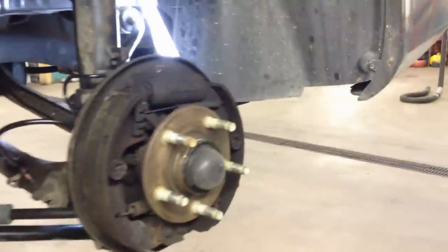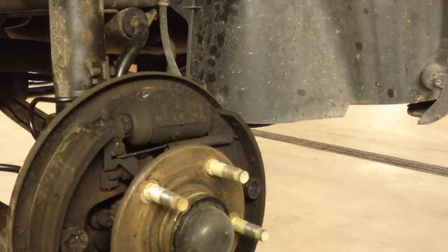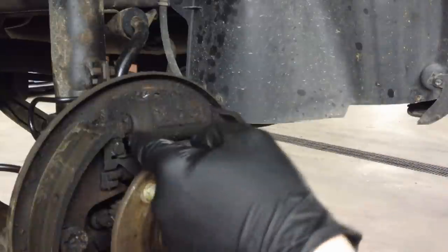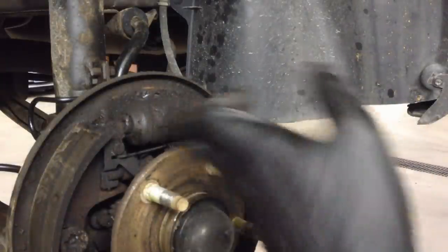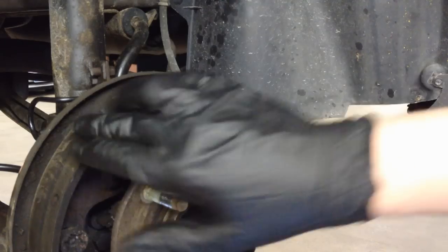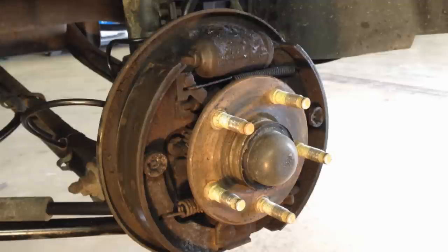You should be able to see it — it's all wet right here and right here, all around where the boot holds the cylinder in. So as I said, these usually have a leak — if it's not moisture, it's an all-out leak — so we definitely need to fix it while we're in here. Otherwise it'll saturate the new shoes and you'll have all kinds of new issues after spending a lot of money fixing it, so might as well do it right.